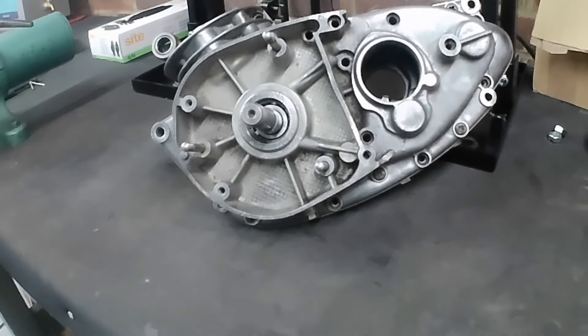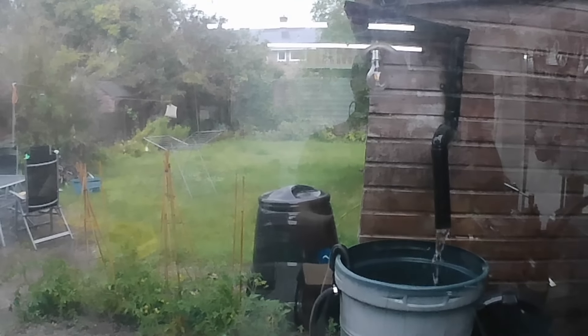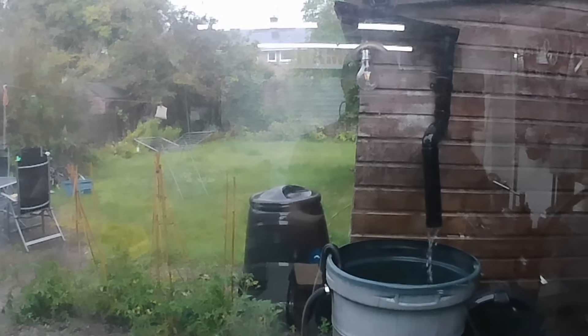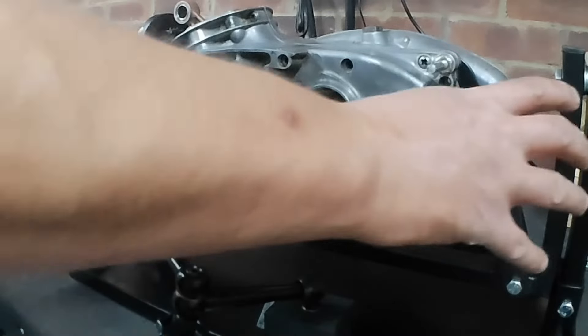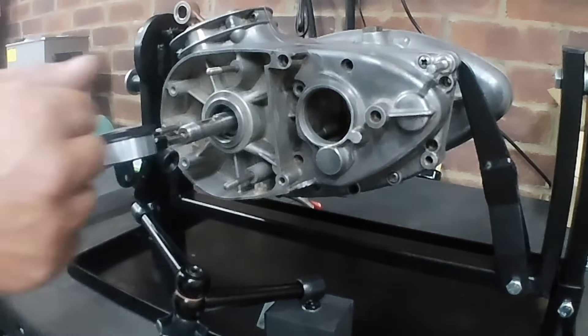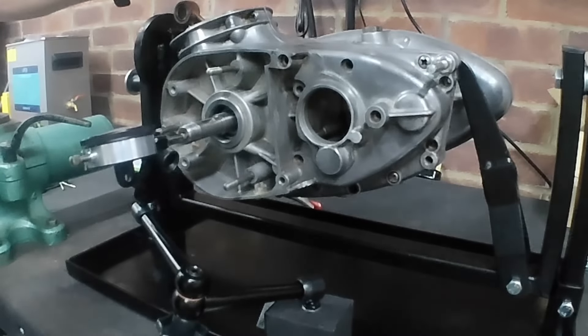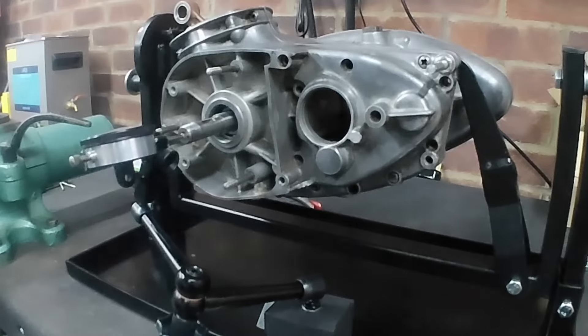I'm going to get it in the engine stand and will bring you back. [Outside briefly] — that's what in England we call summer. Let's get back to the bench. So there's our setup in the engine stand — tightened everything as much as I can to remove any lost movement because we don't want a false reading on the dial gauge clock. We've got our 10 thousandths shim in there, reading everything coming this way and we'll be adding shims to the mag side.